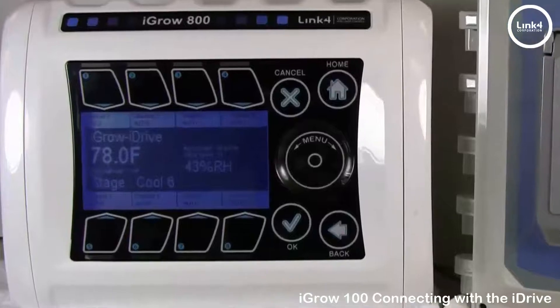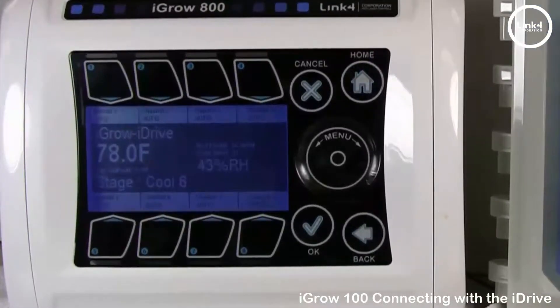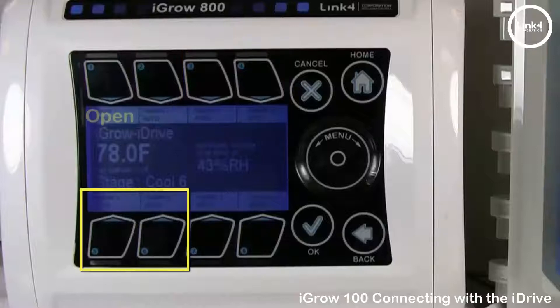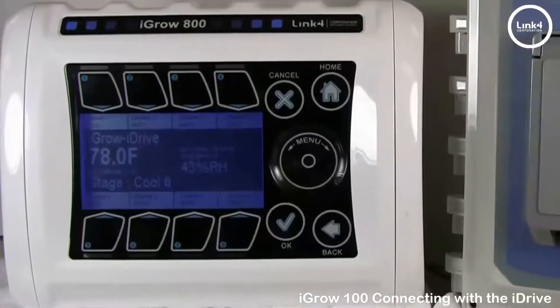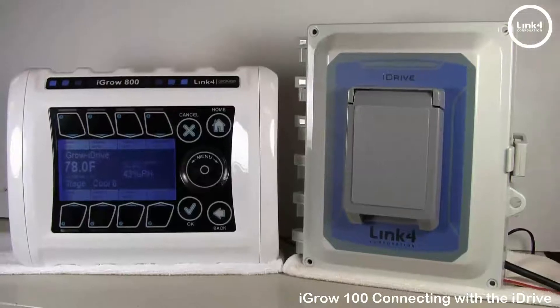With this installation, you will need to isolate two neighboring channels — the first odd and the second even: one and two, three and four, five and six, etc. For your low voltage connection runs, use stranded wire 18 gauge for runs less than 250 feet and 16 gauge American wire gauge for runs less than 750 feet.